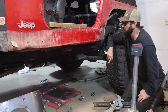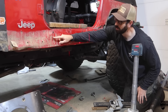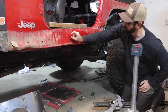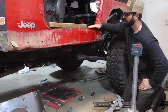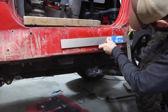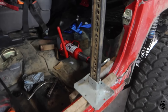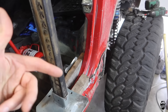There's no way that's going to happen. So what I'm going to do — I don't want to, but I'm going to cut the tub right here, basically like a fish mouth from zero to a half an inch all the way down to the back. At the end it will be a half inch gap and I'll taper it down to nothing, so it'll have something to squish into and this door sill can drop down, giving me clearance for my door. I've got my high lift jack pushing down and my 12-ton Harbor Freight jack pushing this way, so I have pressure coming from both directions.